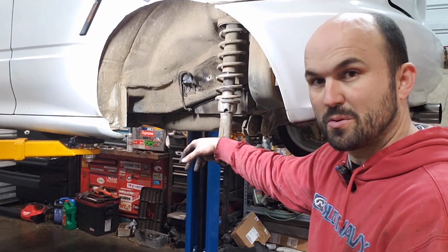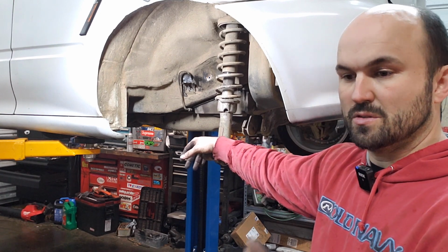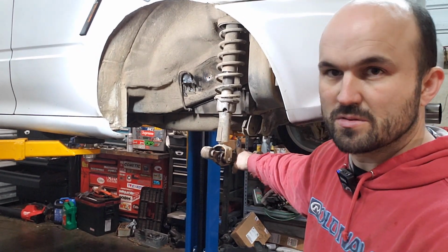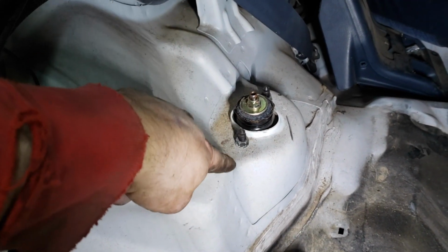So if you're pulling the rear disc off of an Integra in the junkyard, it may be beneficial to you, if you don't have aftermarket lower control arms, to go ahead and snag the control arms too, if the bolt's not frozen in the bushing. So in removing the top nuts, it's the 14s on each side.